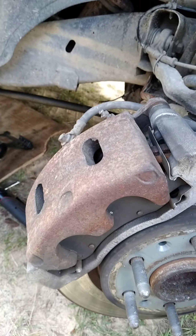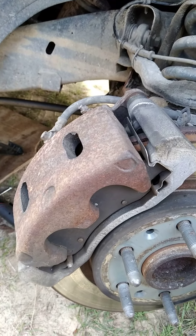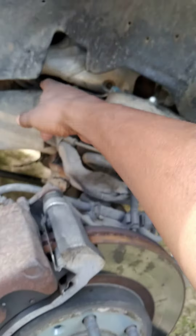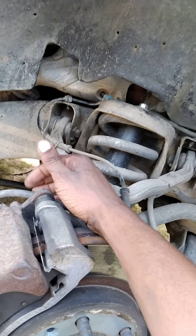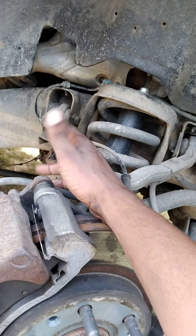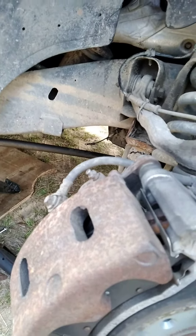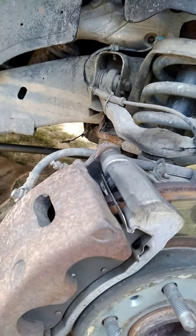This is my first time doing this, so I kind of looked it up on YouTube just to see what it was. I figured it couldn't be much to it, but trying it that way felt kind of backwards — you got this little tight little gap and your hands can't get through there, you ain't got enough room to put a ratchet on there. It's just making you struggle for no reason when you could just drop those two bolts, let the starter hang down, see where the wire is, take the wires off, hook them back up, and throw it back up there.